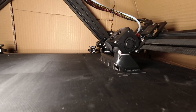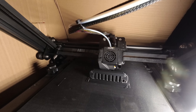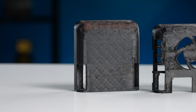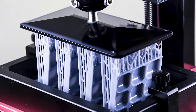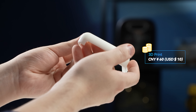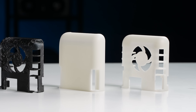We first tried our FDM printer — the results were not great. In the first couple of trials, we got failed examples due to temperature differences between day and night. Even when the printing process went smoothly, the final result was still pretty rough — you could literally see and feel every single layer. It didn't feel like a premium device. So we gave up on FDM and purchased a 3D printing service online using SLA technology, which uses a precise laser to solidify resin. The final product cost 60 yuan, roughly $10, and it was worth every penny — so smooth, so much better.